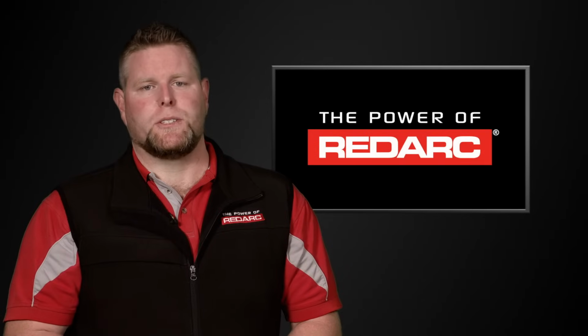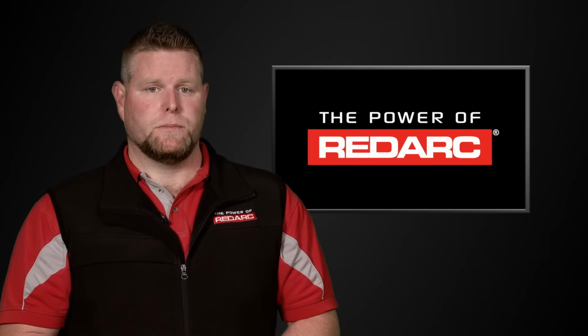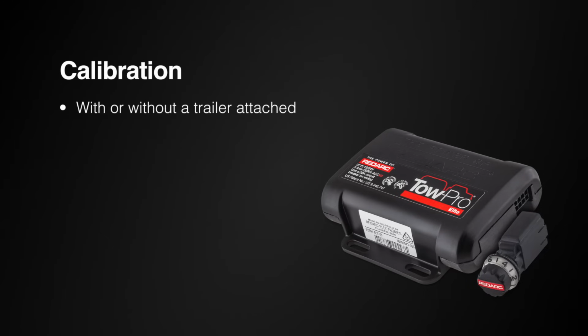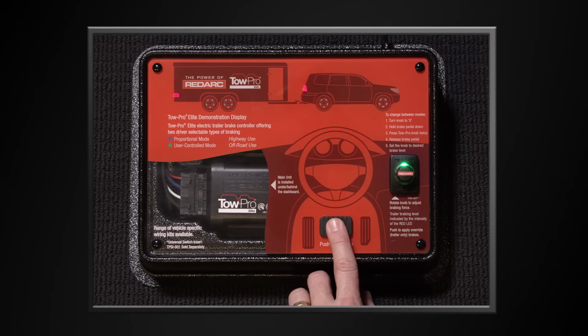A key feature of the Tow-Pro Elite is active calibration, which occurs when the unit is first installed. During this process, the Tow-Pro Elite determines its position in the vehicle. The unit will calibrate with or without a trailer attached, and it constantly monitors the direction of travel. This means the main unit can be installed in any orientation out of sight. While actively calibrating, the driver may observe the remote head LED flashing green-blue.